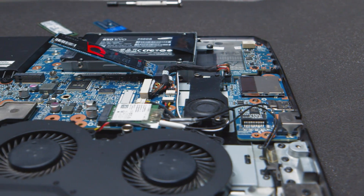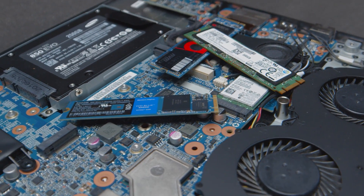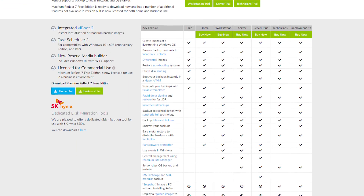If you don't have a drive lying around, our solution will make this process easier and quicker, and also net you a nice new external drive in the process — plus it's relatively cheap. Rather than buy external storage, we recommend you pick up an external USB M.2 drive enclosure. A quick search via a retailer online will bring up options galore, some as cheap as $15. Install your shiny new drive into the enclosure, plug it in, and use the free Macrium Reflect tool available online to clone your existing boot drive. Once completed, remove the new drive from the external enclosure and the old drive from your laptop, switch them around, and boot the PC with the new drive installed — leave the external drive disconnected on this first boot. Everything should be just where you left it and ready to go on the new drive. Once you're confident the new drive is stable and working, you can plug in the M.2 external drive and format it. We recommend waiting a little while before doing this just to be safe and to ensure your files are all intact from the cloning process. Once completed, you've got a shiny new drive in your machine, all your old files and installs, and a convenient speedy external SSD that puts the otherwise redundant old drive to good use.